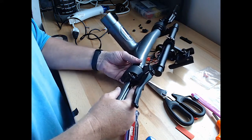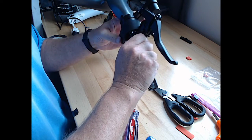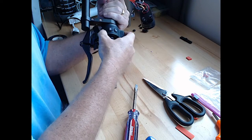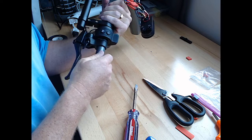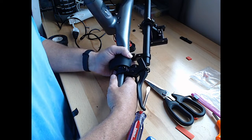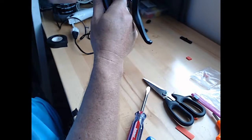I wonder if anyone has done this yet with the regenerative side. Okay, I got that all the way in. Oh, that's no good. That's no bueno there. That rubber is right up against that bell housing. It's just the rubber that's in the way. So if you cut the rubber off, is there any kind of adjustment for this bell? If you didn't have the rubber piece right there, yeah, without the rubber, when I pull the rubber back, there's just enough clearance.